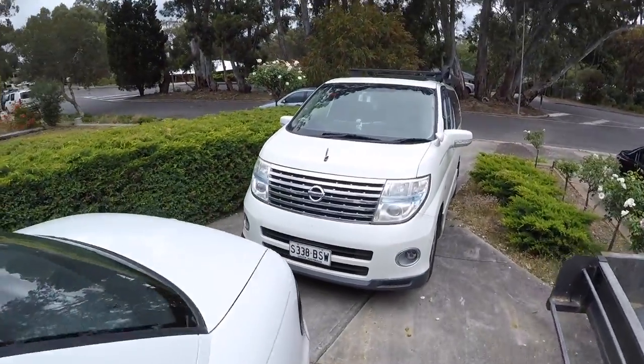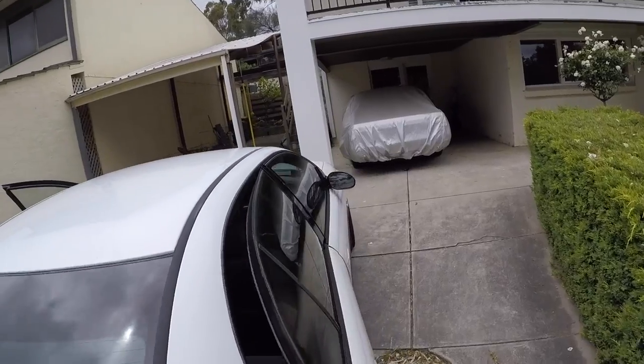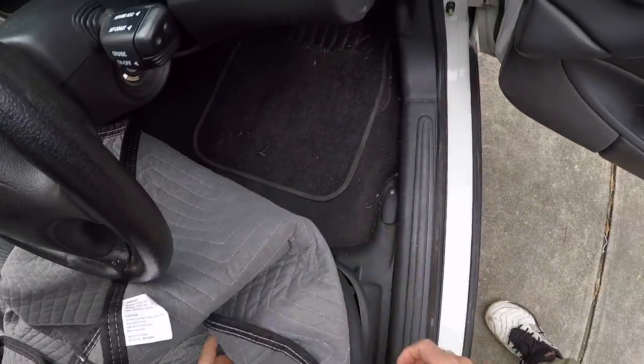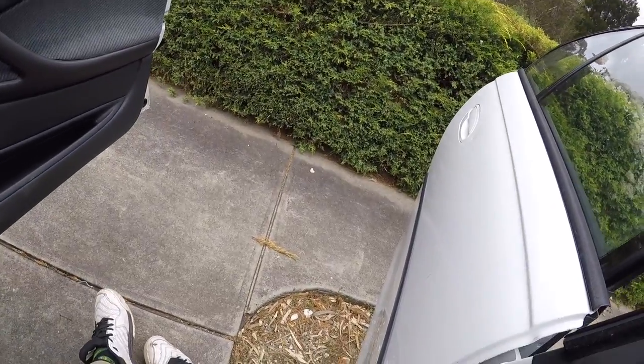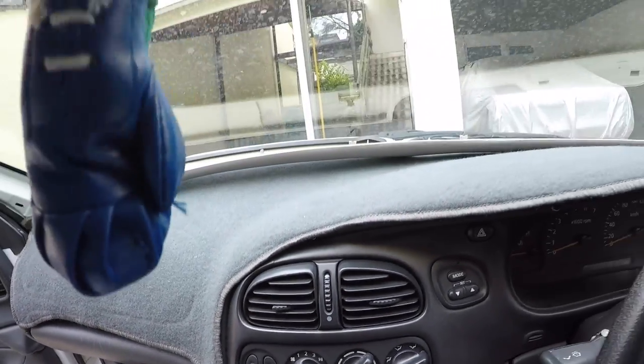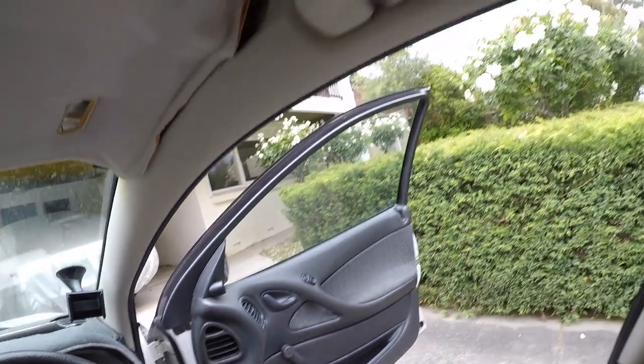They can have sunglasses consoles up the front. You can kind of drop down one side on the left side, and then pull it away from the right side. That's one quick way of getting the boards out, but ideally you probably want to be taking off both sides of the pillars. On the later models like the VYs and the VZs, they usually have a wiring harness stuck up on the board above the driver's side B pillar, so you're going to have to unplug that before you pull down the headlining board.